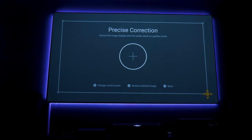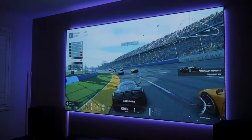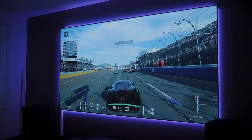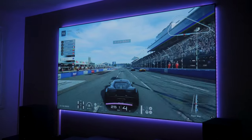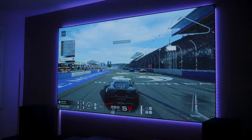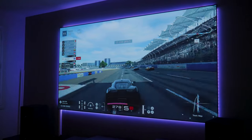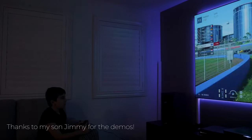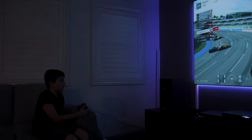I know I often say not to keystone, but this projector doesn't seem to lose any sharpness at all, and that has to do with the optical zoom via the built-in lenses. I think I had a little too much fun playing with this feature, and I was very impressed with how quickly and accurately it lined the image to the screen. For the image, we have a true 4K image which can play back native 4K content with HDR support, and there is the X-View technology which uses the AI engine to detect room brightness, as well as noise reduction, color control, and enhanced clarity. The image looks great in both light and dark environments, and they've done a great job making it a plug-and-play device.